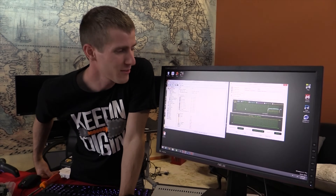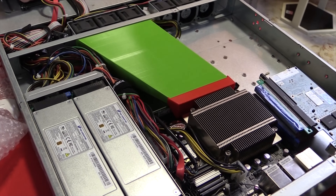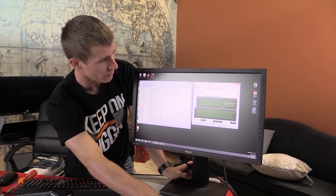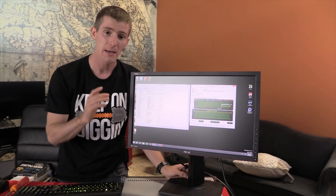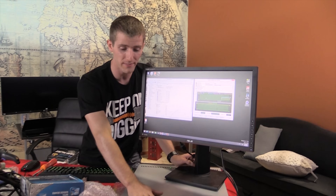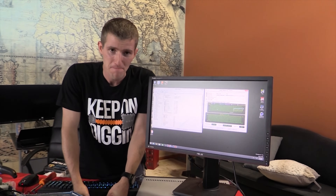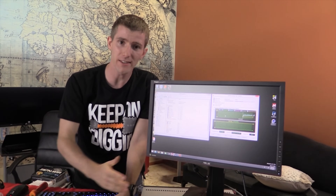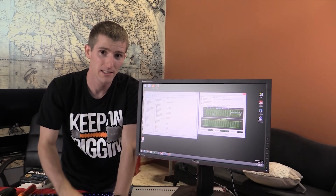There you have it, folks — absolutely fantastic. By using our 3D printed shroud to direct more airflow toward our passive heat sink, we were able to drop our CPU temperatures by somewhere in the neighborhood of about 10 degrees, meaning that even under full load I would be extremely comfortable running this system all the time. It took a long time to get here, but our router is finally ready to load up PFSense and deploy in the server room with our new gigabit connection.